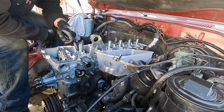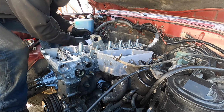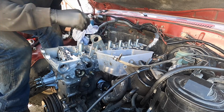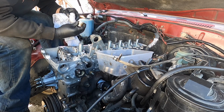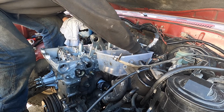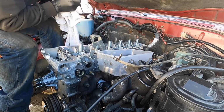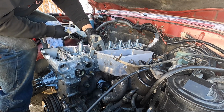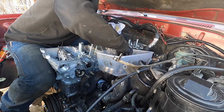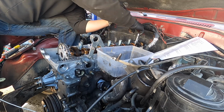So that's oil, but then on the valves, on top of the valve shims, and when the cam goes in, I'll use a similar lube for that. So let me put some acetone. Acetone is really good for cleaning off markers, anything like that in general. So that was I1, intake 1. Now we're on intake 2. Wipe that off nice and clean. I don't want to start dropping these. I3. Acetone is super strong, guys. Sometimes they're kind of tricky to get in. I4, I5. I got my first cam in there, guys. The intake is in, and I still got to torque them all to spec.